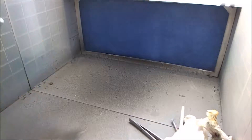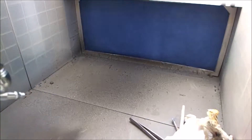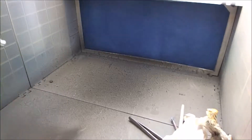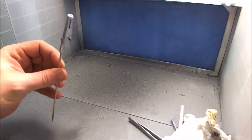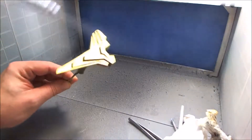So it's just a misty coat first, just to cover all the parts. You don't want to put so much gloss on straight away, otherwise you'll get pooling and things like that - it's always good to do it in small layers. Otherwise you're going to get problems, and with gloss it's very hard to correct any problems, because what you're going to have to do is sand it down.